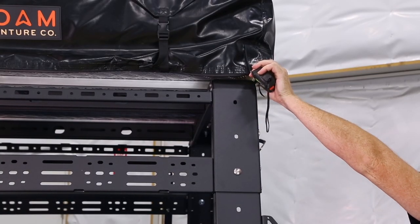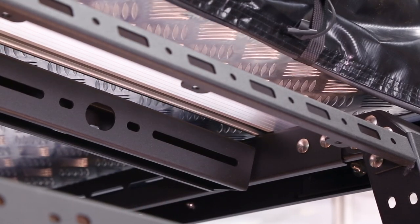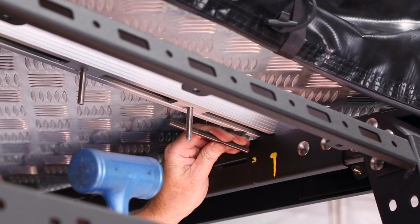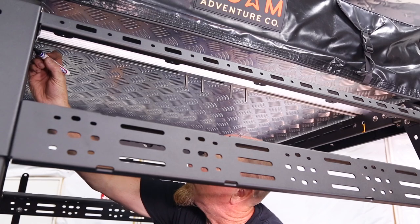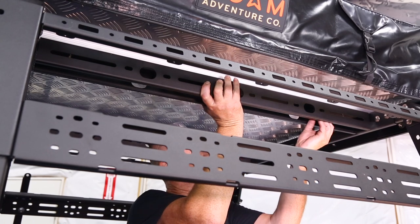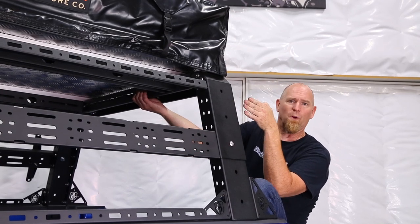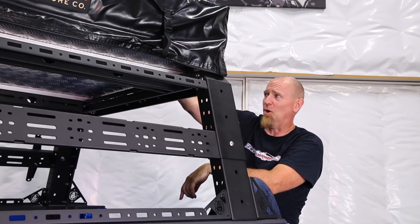What we could do that would be easiest is just move these out — re-drill the mounting holes and move these out enough that they line up. So let's get this centered up and move those rails. First thing we need to do is center the tent at six and a quarter. We've got those rails on the Trek rack moved outboard, lined them up with the mounting brackets, and everything is now bolted in. This tent is solid — let's get it outside, open it up, and see what it looks like.